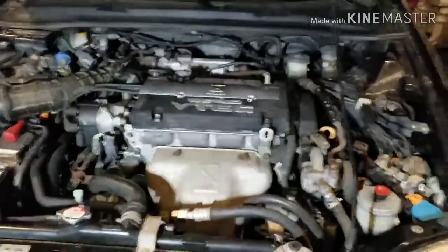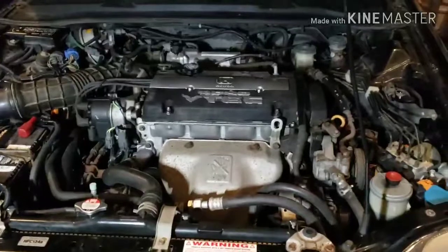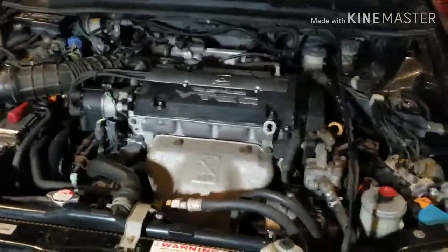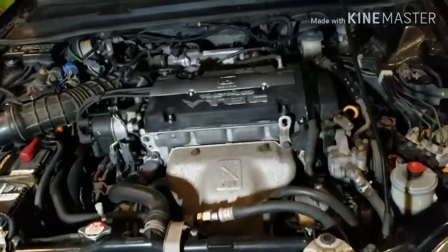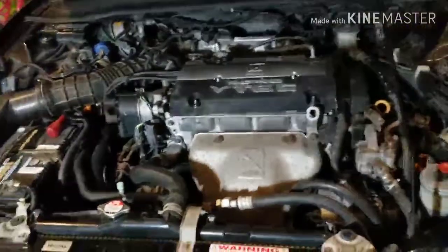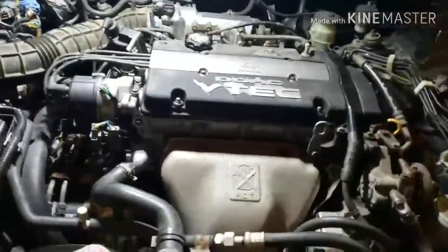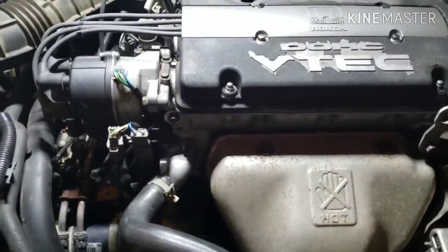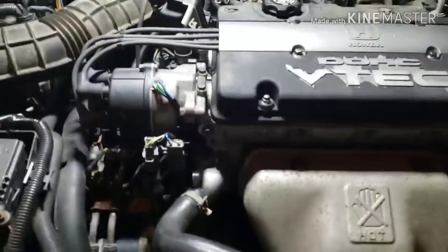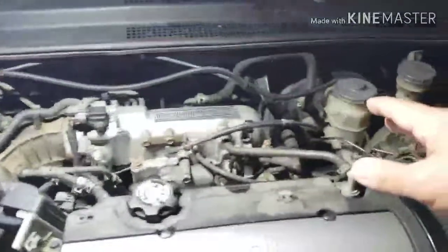So typical Hondas, especially the Prelude, are notorious for oil leaks. You have to be more precise when you're putting the silicone gasket on, or get the right o-rings and stuff. In this case, the oil leak is right below the distributor. I can show you where that would be, but for now the back is fine.